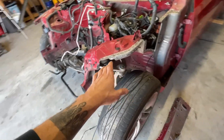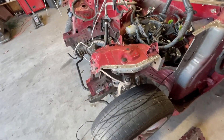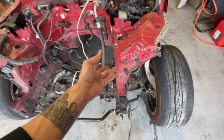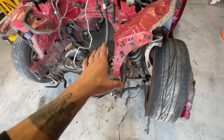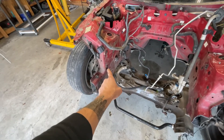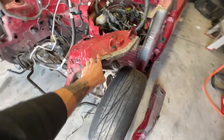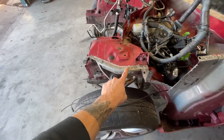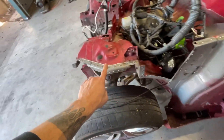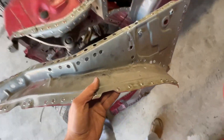All right, so after a little wham-bam-thank-you-ma'am, we got it within five millimeters of where it's supposed to be — good enough for me. Now that the pulling is done, I'm going to lift the car up, pull that subframe back off, cut the rest of this frame horn off, grind down all of these spot welds to where it's flat again and grind them off all the way around. Then I can go ahead and put the apron back on and the underpiece.